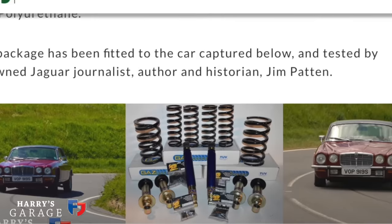The anti-roll bars stay absolutely as standard, but down here, exemplary. You would never guess this had an extra spring rate, and it's helped also by keeping those period tyres, keeping those taller aspect tyres, but fantastic down here. Absolutely a non-issue, and a bit more feel from the steering. It's not super sharp like you expect from a modern car with their ultra low profile tyres, nothing like that, but compared to its standard configuration, it's just completely different.